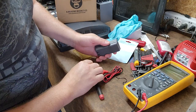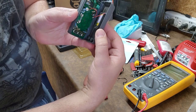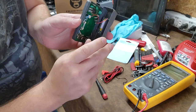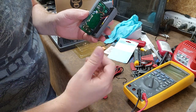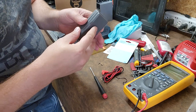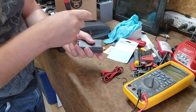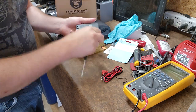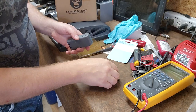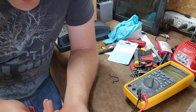There was some corrosion because this battery is alkaline and it is a 12-volt battery — you see it right there. It's a little A23 battery, it's tiny. You can find these batteries on Amazon for about ten bucks for a pack of eight or nine. The corrosion had gotten to the wire, and I had to do some soldering, strip the wire back — all the love it needed to get it back up and going. I bought replacement batteries. Given the time it took to repair, but it was sitting there all lonely on a shelf at two bucks, so I had to get it.